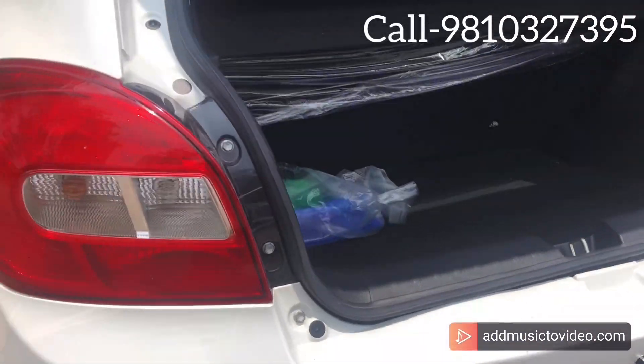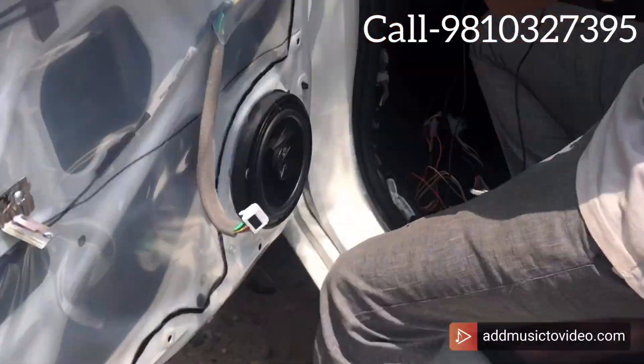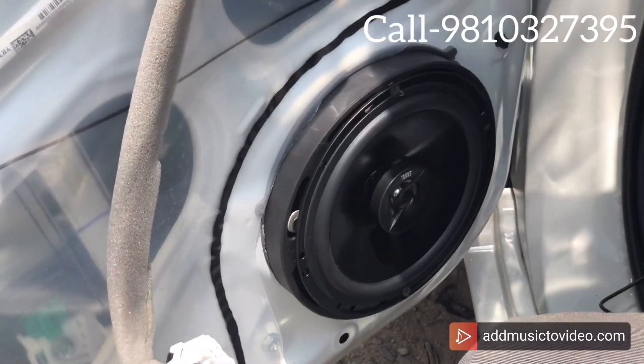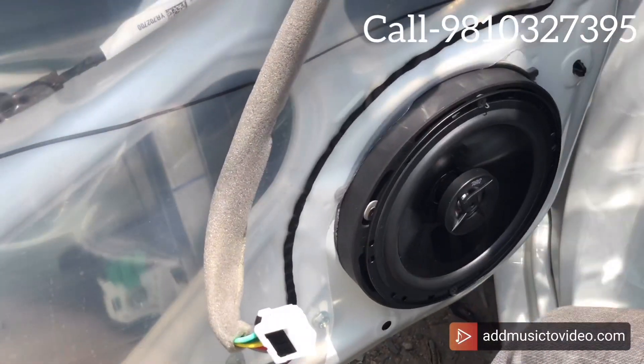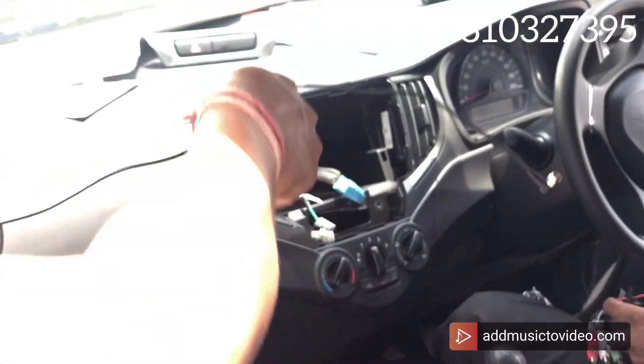As I will show you, we have a camera attached with the stereo. And on all 4 doors, we are putting coaxial speakers — JBL 300 to 350 watts. We have used water guards below so that the speaker's life is extended and it will vibrate well. The speakers are just normal coaxial, so this car needs to be damped.